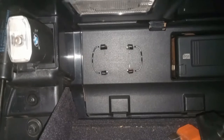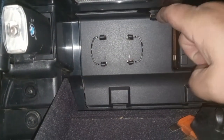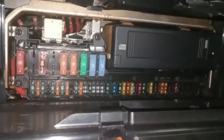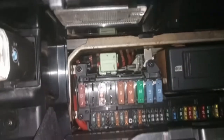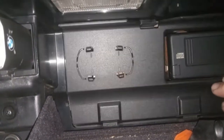There are little clips here — there's two clips. It's actually one there. Sometimes they have two, but this one has one, I guess, because of the CD changer in there. And there is the one fuse box. It usually comes with a little card with a template that shows you what those fuses are for. I did look at the owner's manual; it really didn't state what each fuse was for. So it's important to keep that paper in there.